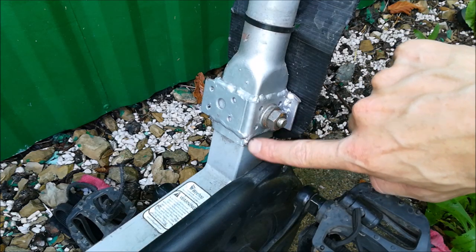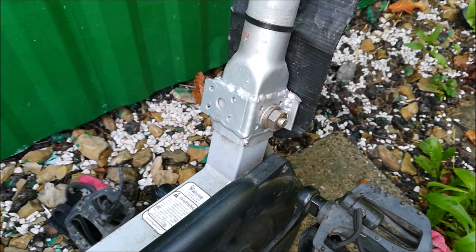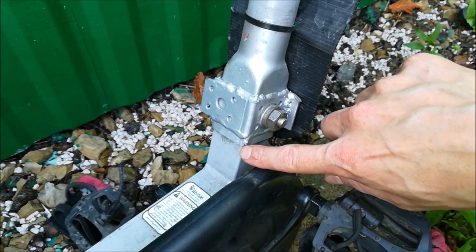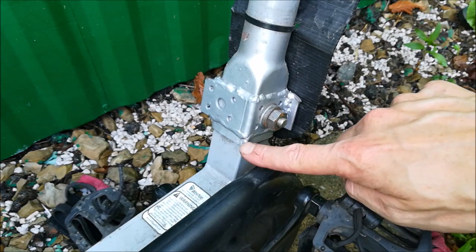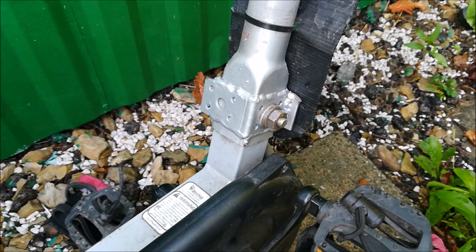It was the original part here, between these welded two parts, these welded two angles, started cracking along the edge here, because the brilliant designer of this piece thought that it would be fitting to make two square tubes sleeve onto each other, and it didn't occur to him or her that there's going to be cracking here. There was no preload here, so it would be loose, it would work itself out of here, and the stress riser around this edge would cause cracking here, here, here and here, especially in this place and on the other side, as the inside piece was working itself within the outside.